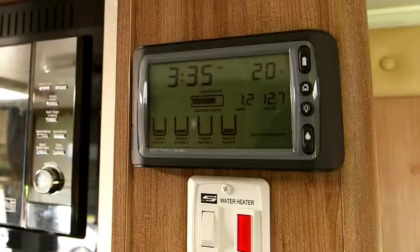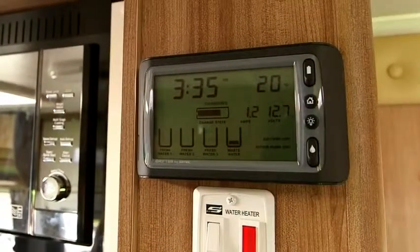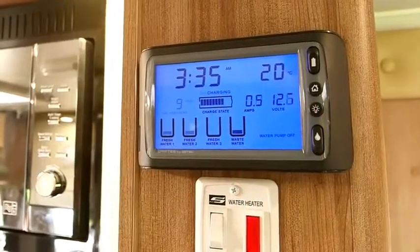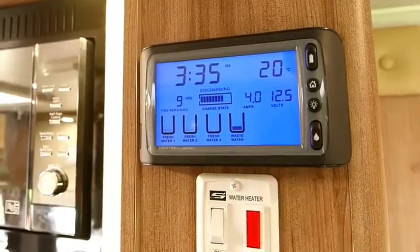The drifter control panel monitors water tank levels and the 12V battery charge state. It will show you the volts and amps on your battery. The switch on the top is your battery switch — this will either turn on your battery power or isolate it. If the battery is off, it will display 'battery off' and 'water pump off' on screen. To turn on the battery, flick the battery switch down. The battery switch needs to be on to charge from any power source. The bottom switch is your water pump switch, which will turn on your 12V water pump — flick the switch down to bring up your tank water levels.